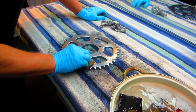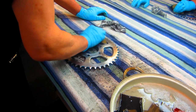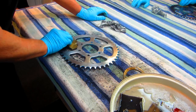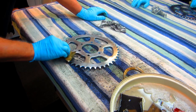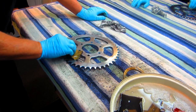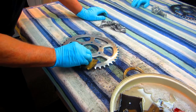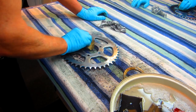As long as I can see on my bench here that I don't have any really deep scratches, pretty soon I'll be ready to run over to the buffing wheel and buff this out the way we buff these parts out, with especially a steel part, black rouge first, red second, white third, rake the wheel between, unless you have separate wheels. That's the part that can be time consuming.